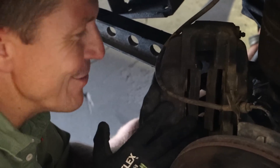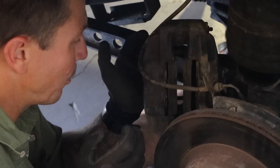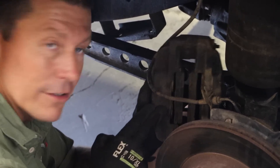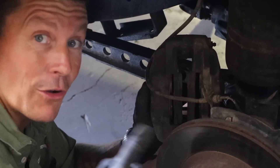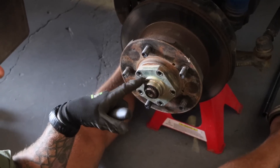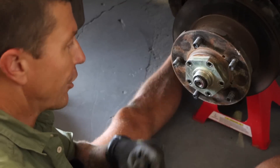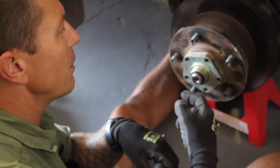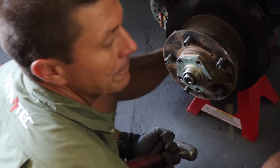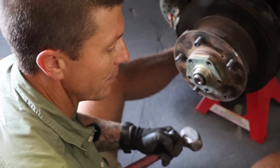With the front I know a little spot for it — I push it up onto the track rod, onto the steering arm, and it's solid there. The back ones I do tie off with a cable tie or a bit of rope. To remove the drive member: with the rear it's easier — I just pull the drive member off and the half shaft and everything comes out with it — but obviously you can't do that at the front. Still a pretty simple job. I don't use the paper gaskets that come with these; I'm always carrying a little bit of gasket maker. This stuff seals anything, far more reliable than the factory paper gaskets.